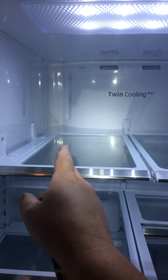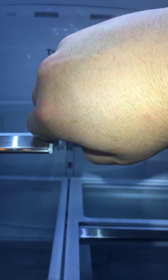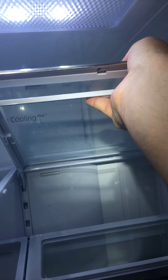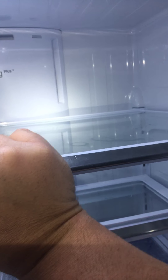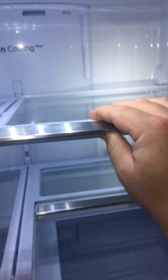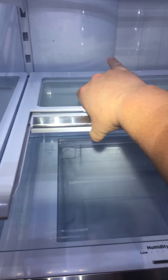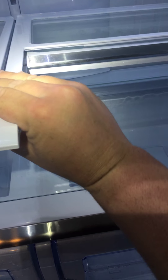For the upper top left-hand shelf, this one is real easy — it's got a little clip here. You lift up on it, set it down, lift up and unhook it so you can rinse it. To put it back, hook it in the back and it'll hook right in. Your next row is the same thing — they hook together, you just lift them up and pull out. No big deal, very easy on these ones.